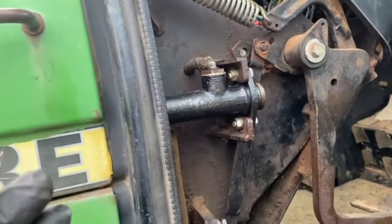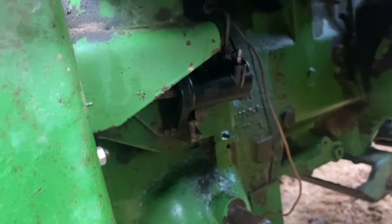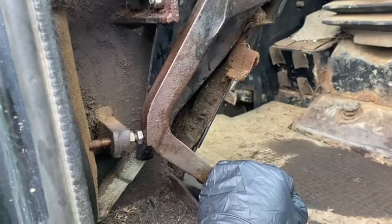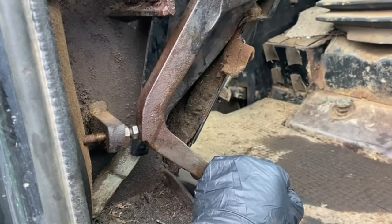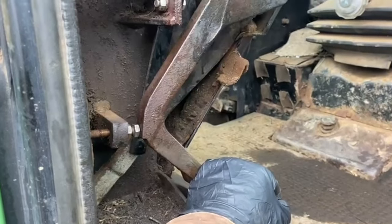The best thing for these master cylinders is to get your slave cylinder underneath and do a reverse bleed — that's always the best way. You can go the old conventional way: push the clutch down, push all the air out, release the nipple, close it up so it doesn't suck back in, then push again. But this is all going to be reverse bled.